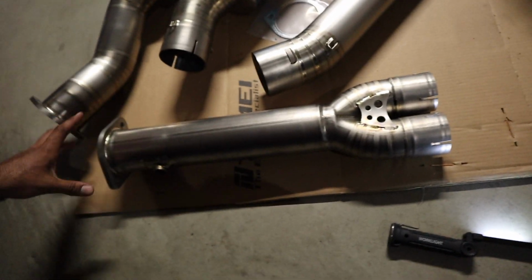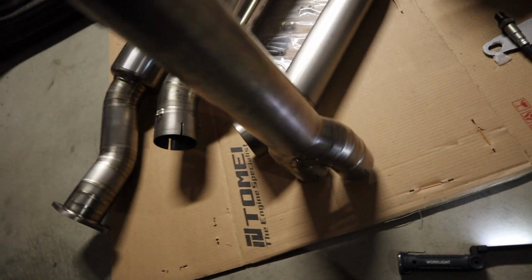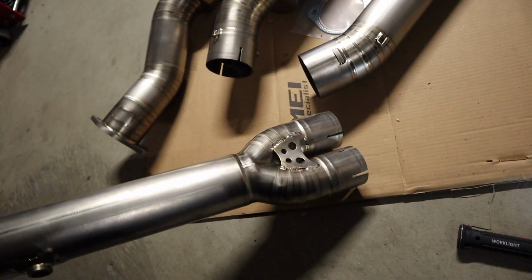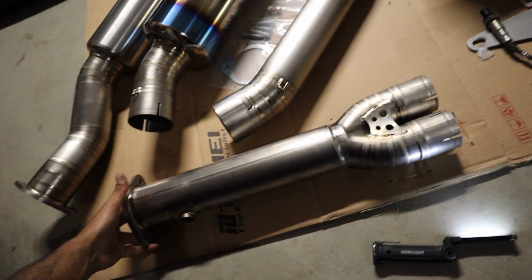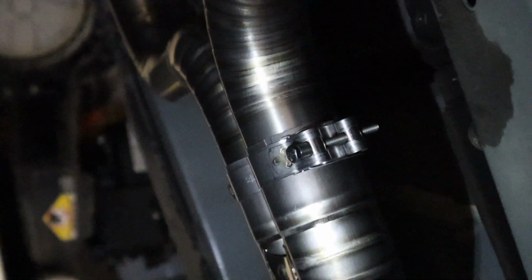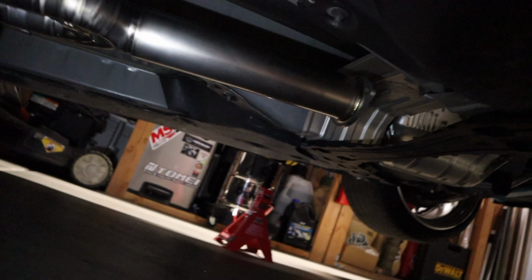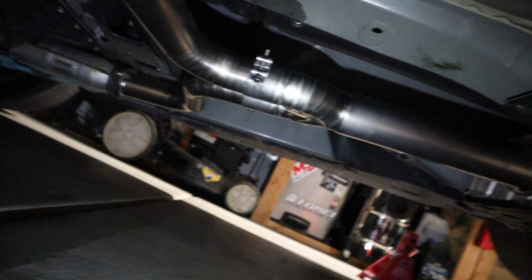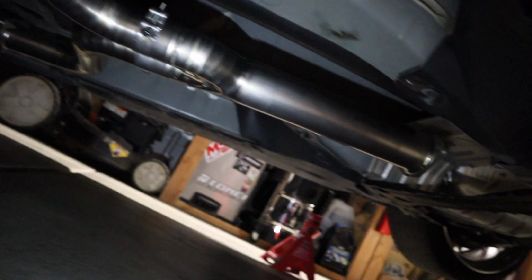So this is the other piece of the Y pipe, and it's gonna go ahead and mount up. Well, I guess both ways is the same. So yep. Alright, just like that, we got the clamps on. So these clamps, they come with a marker. Didn't really make sense, but I pretty much got them pretty tight. You don't want to over tighten them though, because it can bend the titanium. But yeah, that's pretty much the Y pipe installed just like that. I forgot to use the new hardware. I'm gonna do that, and then we'll connect the rest. So the next piece we're installing is this resonator.